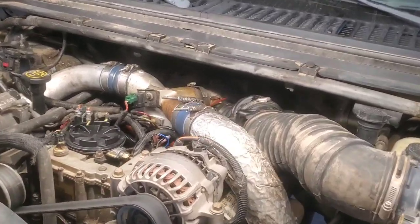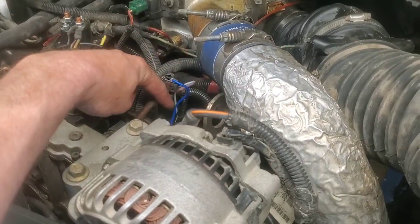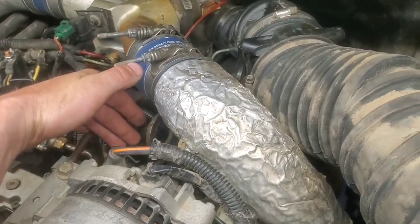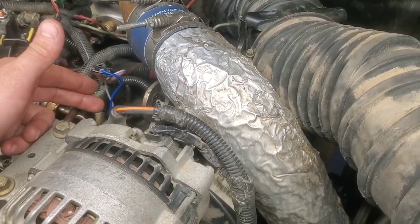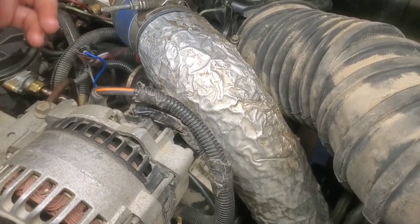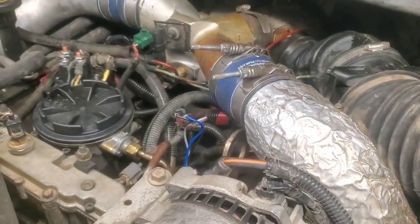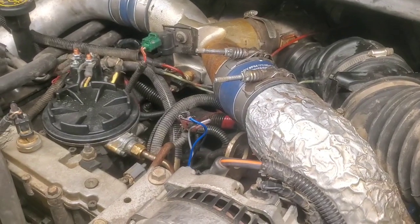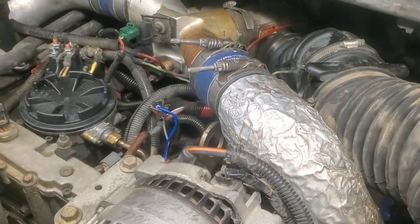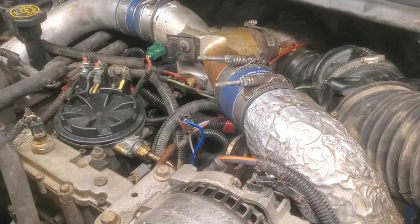We were losing the signal — the PCM wasn't getting its signal from this sensor, and it was losing it somewhere. For us it wasn't a wiring issue — the sensor itself wasn't operating like it's supposed to. You might have to trace wires and follow the signal. One thing to check is your wiring through your plug down there. See how this has a bunch of tape — I had fixed wires that were rubbing on the valve cover. The signal wire — a purple with white stripe — sometimes it's down there rubbing on the valve cover, causing ICP sensor reading issues and that 1280 code. Hopefully this helps you out, thanks for watching.